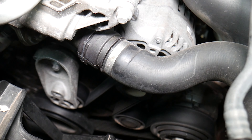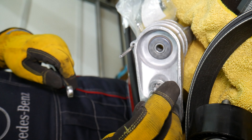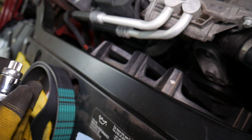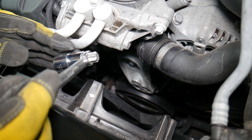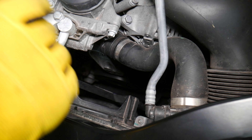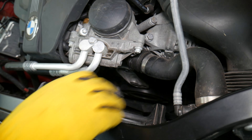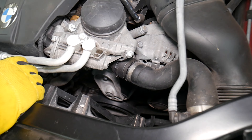We're going to remove the belt and the tensioner now. We're going to use a Torx 60 star bit. There is a special tool for the belts — we don't have it, but we'll put the link in the description if you want to buy it. We'll use the Torx 60 with a wrench. It's going to be a bit of a challenge if something slips, but we'll make it work.